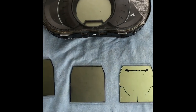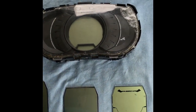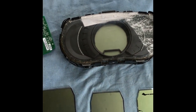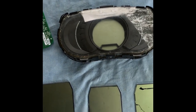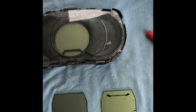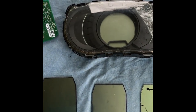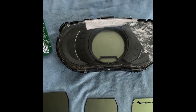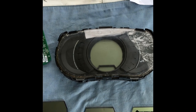The other thing is that if you try to repair it and you're new in the Sea-Doo world — the problem is you have to marry your key with the display. So you can order a new display, but you have to go to the Sea-Doo dealer and they must connect your jet ski to the computer to marry the key. Keep this in mind: you can't just order a new display and think it's plug and play. It's not working — your jet ski will start the buzzer and only show on the screen: reading key, reading key.